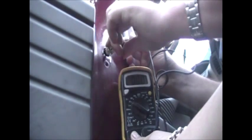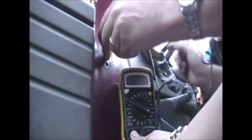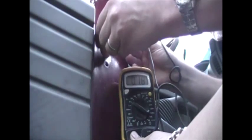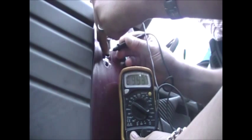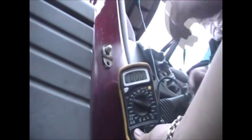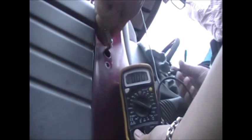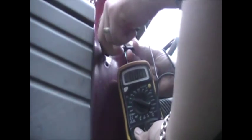I just wanted to show you — there's a red wire with a white line and a black wire. If you put a multimeter to both of them, both wires read a 12-volt power source. What happens is the light doesn't actually work until you bolt it back in; it gets its earth from when you bolt it back in. So both wires inside are active. It's a negative feed switch, so it's not dangerously active — it just earths out, and that's how it triggers the switch.